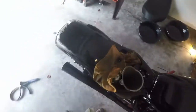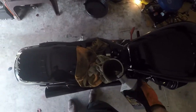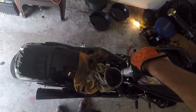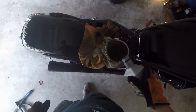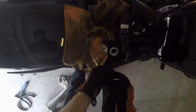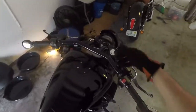Okay, now we can pour in the rest. Our bikes take around 4.5 quarts of oil, so give it a little more. There we go — a little shot of the liquid gold. Put the dipstick back in, then start the engine one more time.